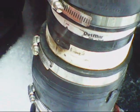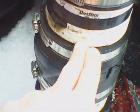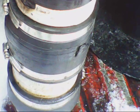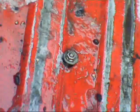When I first mounted the blowers I had them horizontal to the truck box, but that causes condensation and water to sit in the pipes, which freezes up and causes more corrosion. Having the blowers placed vertically is better because water will naturally drain out. For the back valve I used the same type of sewer slide valve instead of a tennis ball, and it's operated at the back of the truck.